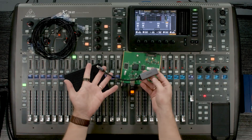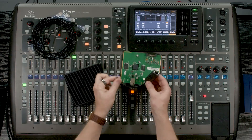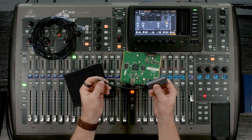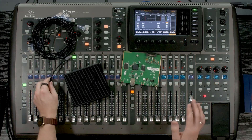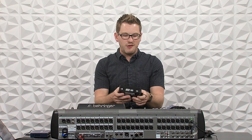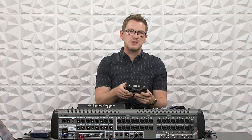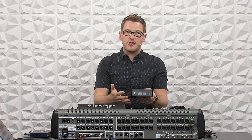In my case I have a MacBook Pro — a little bit older one — but it does have Thunderbolt ports, so I have a USB-C to Ethernet adapter. Now, the computer is required for controlling the plugins, so there's a little bit of controlling that happens on the computer, but no audio is processed on your computer. Another benefit of Waves SoundGrid is you can add multiple servers for redundancy — not only can you have all your plugins processed on one server, but if one server goes down, the other will instantly pick up with minimal audio loss.